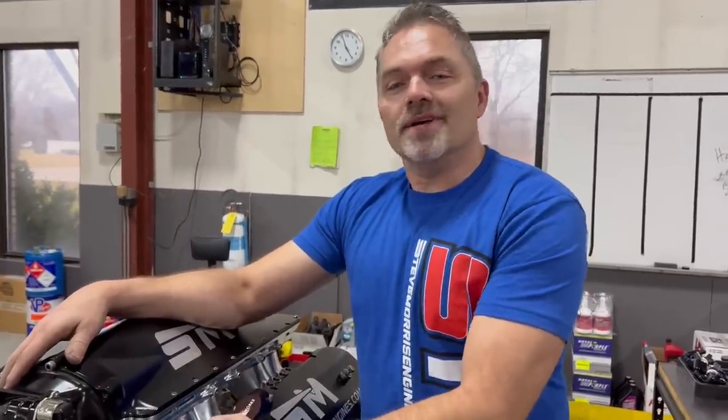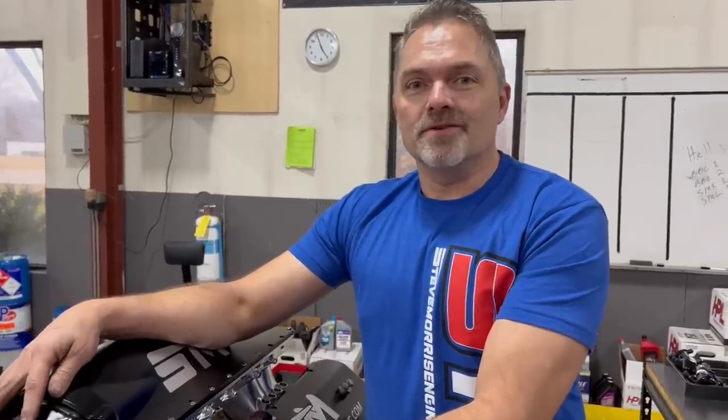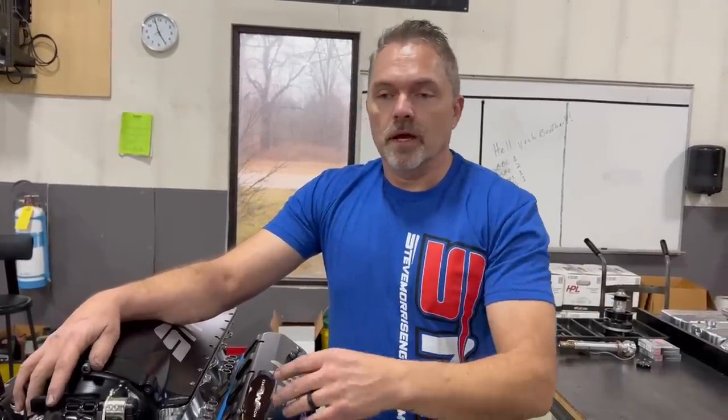So I didn't design this to be making 57 pounds of boost. It's taking it, it's doing it, or it has done it. I have told Garrett several times that you are exceeding what we built this for. If you wanted to have something that makes 60, 70, 80 pounds of boost, you need an SMX. The limiting factors on these are, you have to understand, we could put my SMX rods in here, okay? But then you really need the SMX crank. Well, then the block is the problem, because the block, it's cast. Cast parts will crack. So then you need a billet water jacket block.